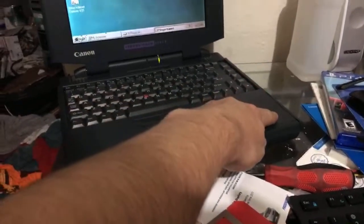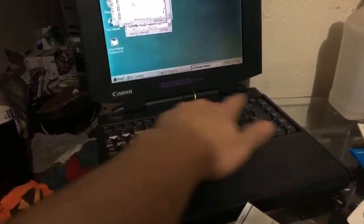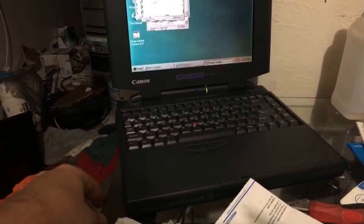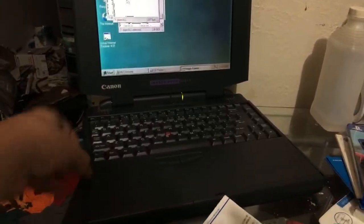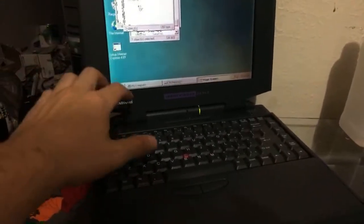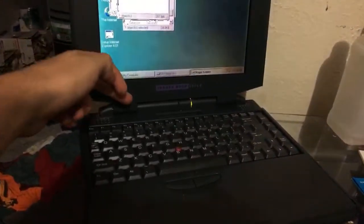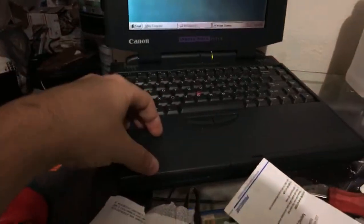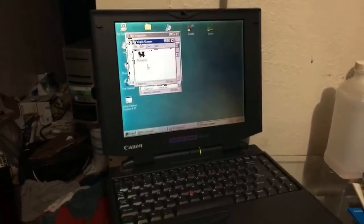So what you've got to do is you take out the hard drive, you take out the battery, you take off the little cover for the RAM expansion bay, and then you take out three screws in the back. There's four screws underneath, and then there's another four screws where the hinges are. Then you open the screen up, and first you take off this piece of trim, and then you take out two screws, you take out the keyboard, there's three flex cable connectors on this side, you then take out two more screws, you then take this entire palm rest off after taking off two more screws underneath the keyboard, and then the floppy drive is right there. And it was just a flex cable on the floppy drive. This thing is dead simple to work on.